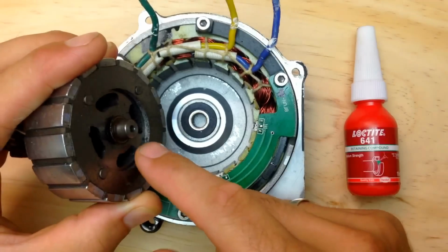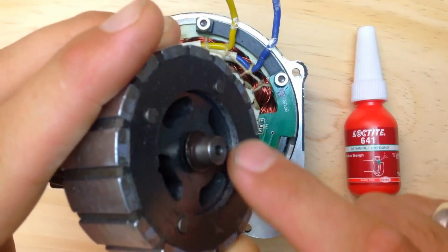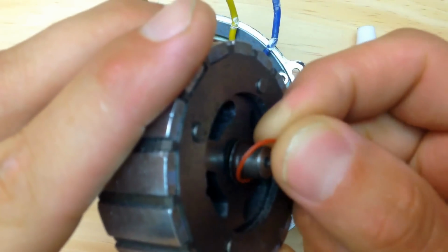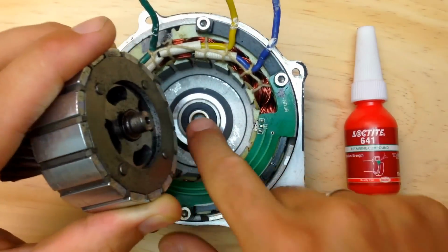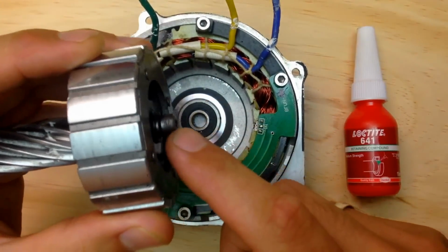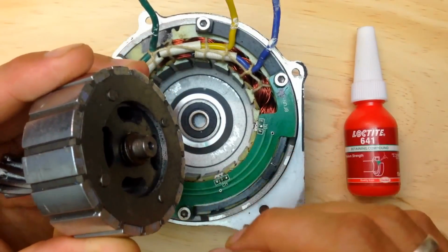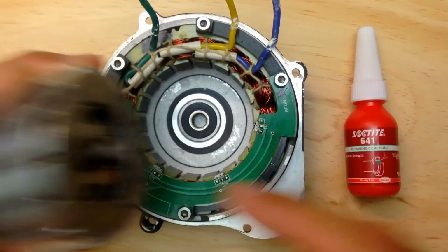You can tell. You're going to see there's some black dirt, like black dots here, as you see, right? So this is actually a melted rubber ring. Okay, so you used to have a rubber ring here to actually grip this thing inside the inner bearing, but the rubber ring is gone for some reason, and now you have a lot of friction as this thing slides inside the bearing, and it ends up wearing down to the point that you might not be able to recover. But if you notice this noise in time, you'll be able to stop, open, and actually